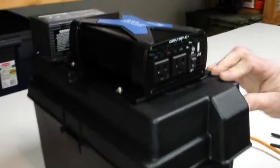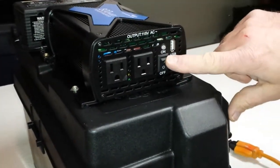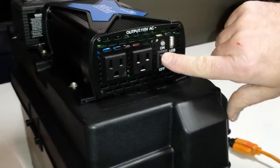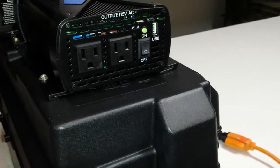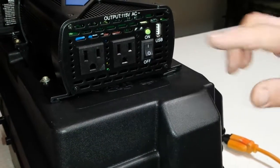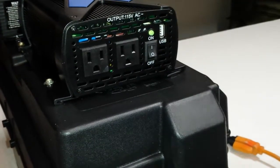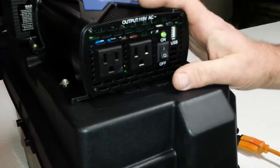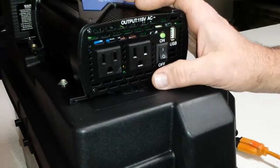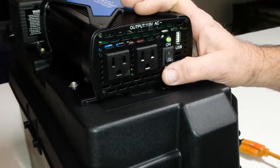At this point, you're ready to actually use your inverter. When you turn your inverter switch to on, you're going to see a red and green alternating flashing light — it's going through its diagnostics. When it goes to solid green, it's actually ready to plug in devices like your refrigerator, freezer, entertainment center, lamps, laptop, tower, or other devices like that.